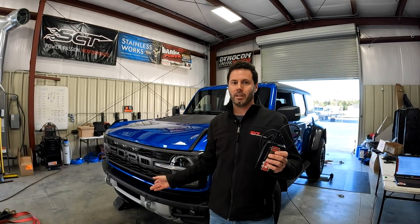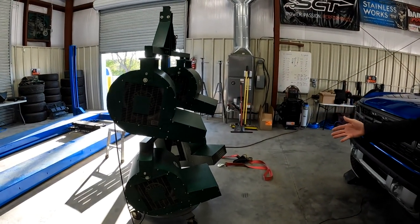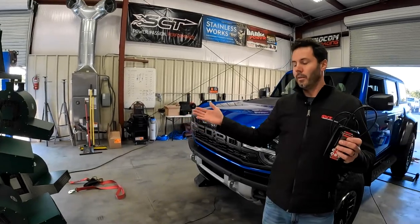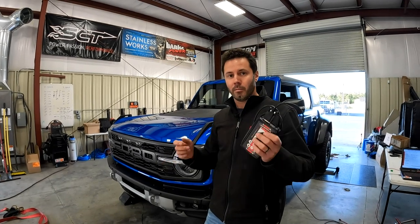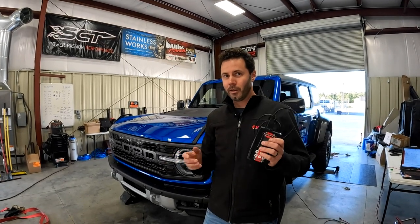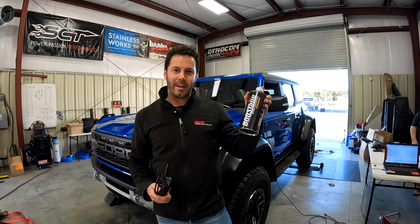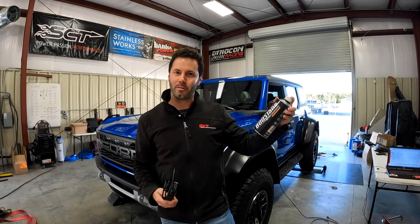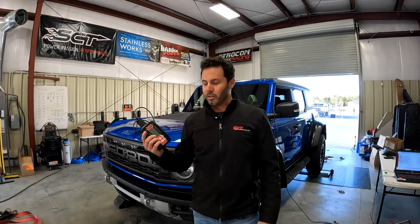None of that stuff is really going to make any difference on the dyno — the intercooler makes the difference out on the road. Even though we have some fantastic fans here at Five Star, there's no substitute for being out on the road. We're going to run stock, put the Whipple tune in, run it, and then just to make things a little extra spicy, see if there's anything else left on the table. We've got a can of professional strength Boostane — throw a little bit in the tank, got about 10 gallons in it right now, so probably about half a can to dose it up. That'll get us the most we're possibly going to get out of just a tune. So let's spin the rollers and see how she does stock.